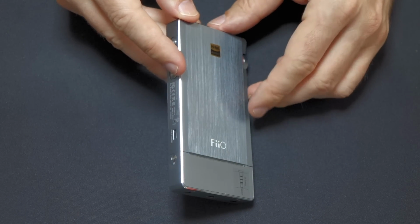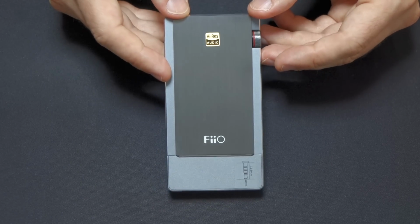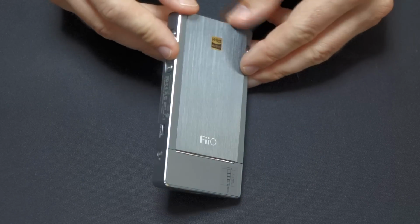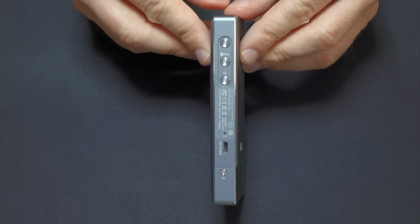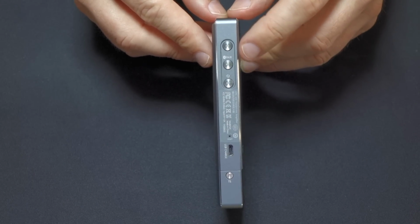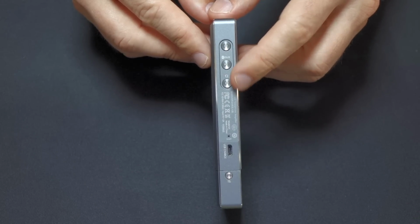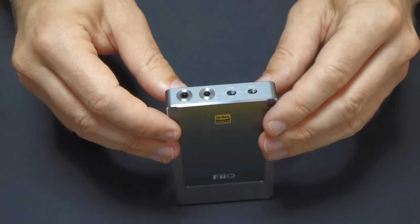Of course, the reason it has two separate ports is that if you connect a port that has charging as well to something like a phone, the phone is going to say, no, we can't send that amount of current to charge your device, and just disconnect you. So it needs the two ports. Of course, on the side, you have playback controls to use over USB, your back, play, and forward. And these double also as input switching and pairing. So basically what happens, well, I'll show you that as well.